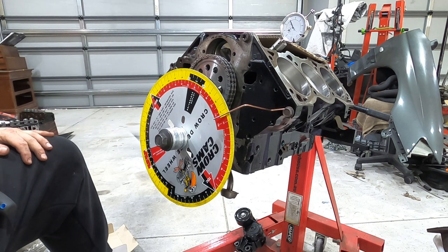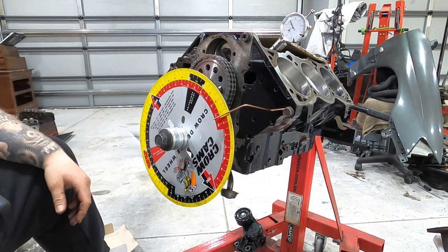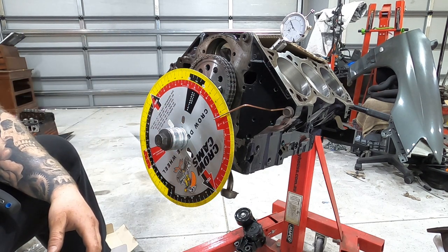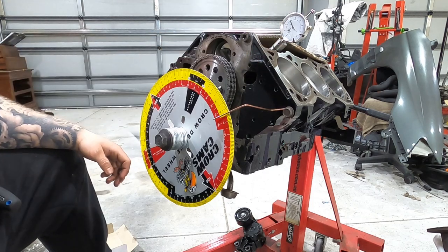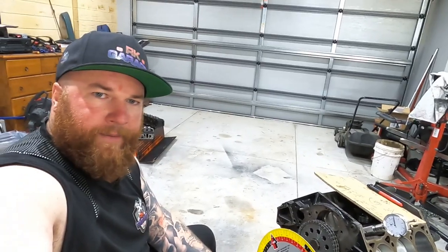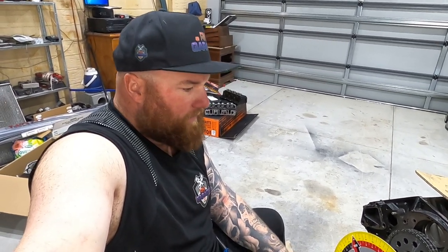So now I'm going to tighten this up nicely, and then start to finish putting the timing cover on, get that gasket on, everything else around it, and we can start to check for piston to valve clearance. So I'm gonna get all that done. If you're still here, it's gonna be the end of this video. That is how I dial in a crank, camshaft. Next video, slap the heads on, check the PTV.